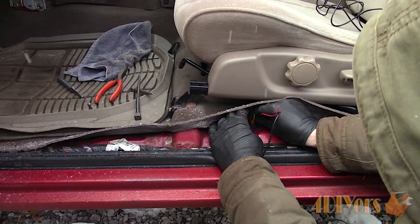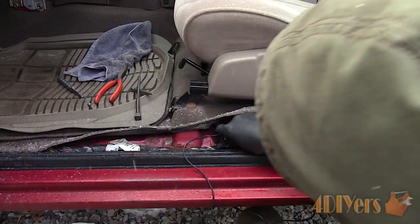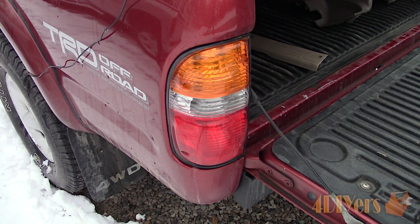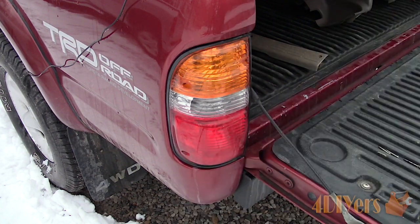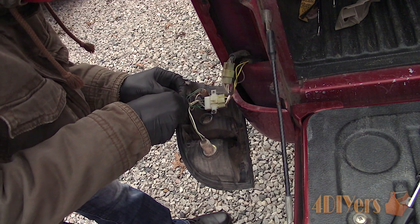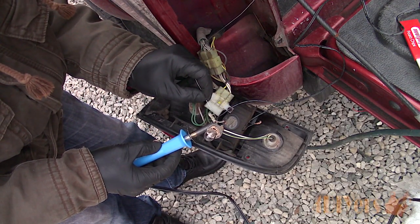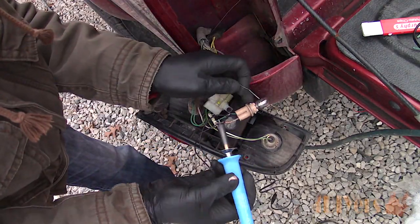Moving on to the backup camera. The video wire is fed through the floor under the driver's seat. Pull back the tape on the factory wiring then insert the camera wire through here — once wiring is finalized the tape will need to be replaced so the grommet is sealed up again. The wiring is run along the same route so you'll need to go under the truck. Since it is exposed to the elements, split loop casing is highly recommended to protect the wire. Remove the tail light — there will be four Phillips screws holding it in place, and there are two different sized screws so don't mix them up. Pull out the tail light. The reverse camera wire requires a switched power source for the reverse lights and ground — I will be cutting both wires for the bulb. Using a razor knife, cut off about three-quarters of an inch of casing to expose the conductor. I'll be using a lineman splice. Strip the wires on the supplied power plug for the camera — red goes to positive and black goes to negative. For this truck I found the green to be positive and the white is negative.